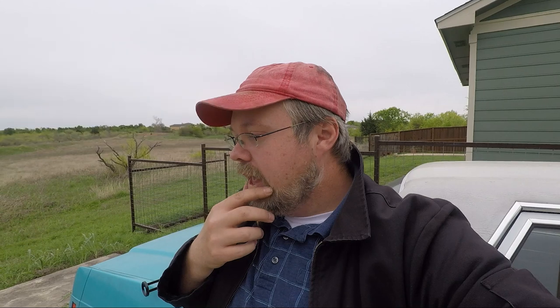If you have 350 to 450 horsepower, you step it up to a 3/8ths line, which is a little bit bigger, and then 450 to around 600 it's a half inch. That's way more than we're looking for here. Now that I have that knowledge I'm trying to put it together into a cohesive package that can actually push the fuel forward, but it's been a challenge. We're going to have to go to the store and try to find an adapter piece that will fit.